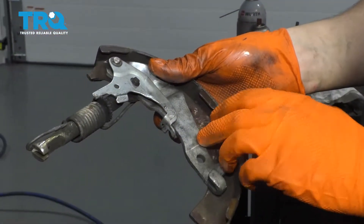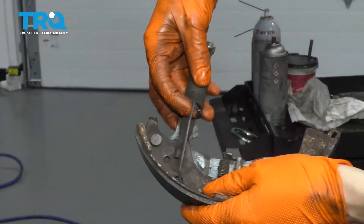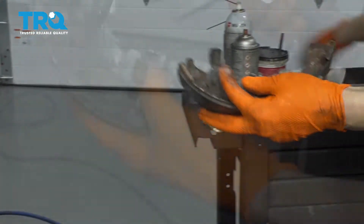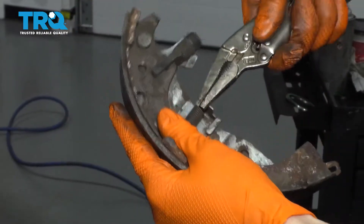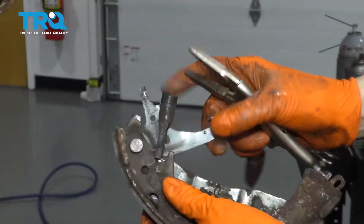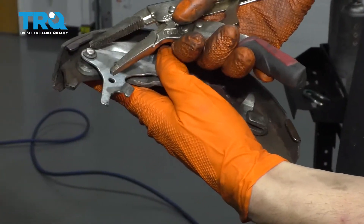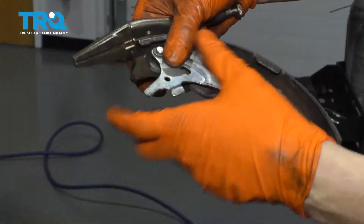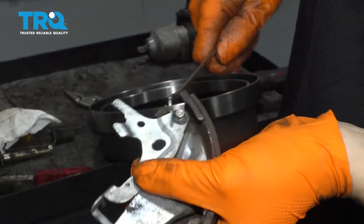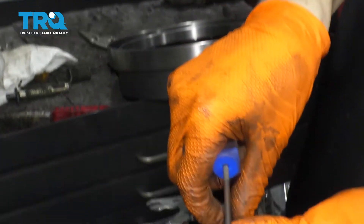We need to take this lever off as well as the adjuster and move them over to our new shoes. Take the spring off — that pulls off half of the adjuster. It has to come apart anyway so I can clean it. There's a little spring on the back of this lever; I'm going to grab it with some locking pliers and remove it. That'll release the lever and let you remove the rest of the adjuster. Right here on this pivot pin there's a C-clip locking ring that needs to be pushed out. With a pick I'm going to try and remove this locking C-clip — these go flying, so make sure you either have a new one or can catch the old one.